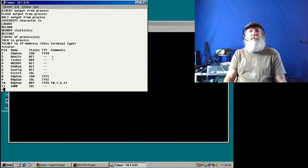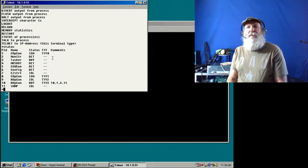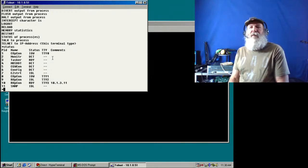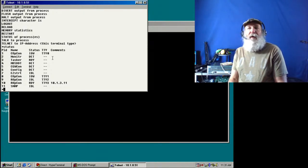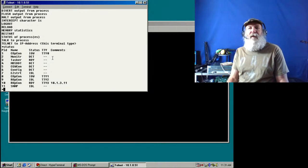Again, this discussion is coming up a little bit on the Facebook group of people still trying to locate functional Ethernet adapters that they can use on their microchannel systems. And me responding to say that the token ring adapters are very common out there. There's a lot of them that have been scrapped, but still available enough to be able to locate and buy. There's still enough quantity out there of very good adapters, just that they are token ring. And using those adapters to set up a token ring network, certainly relatively modern systems can participate on a token ring network as well.